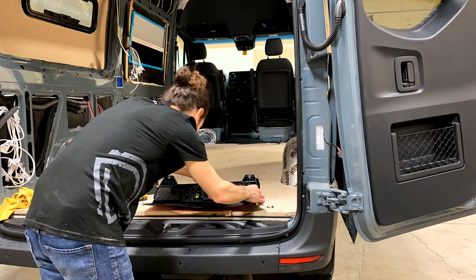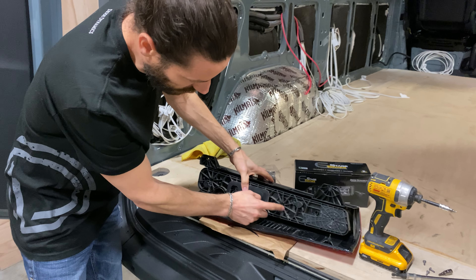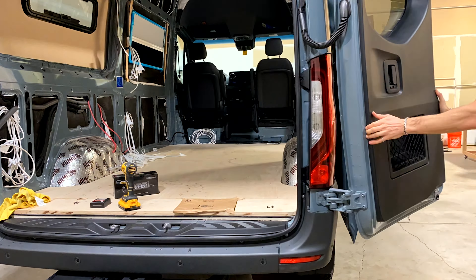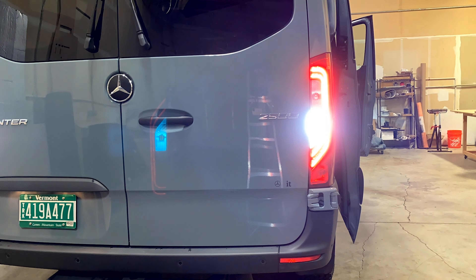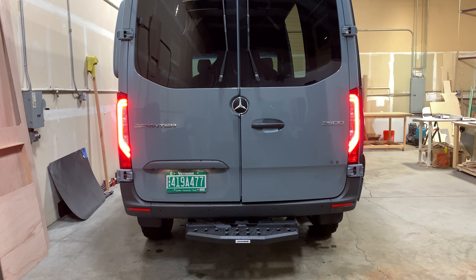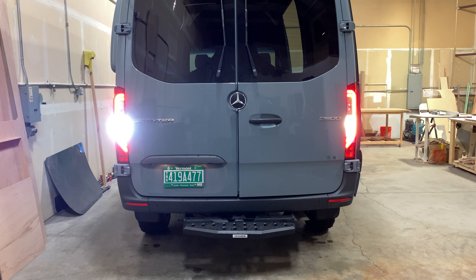This section is held on with one, two, three, four screws. So you just remove those four screws, pop this off, put your bulb in, snap it all back together, and the whole project's done. We'll show you in a second here how much brighter it is once you've done the replacement. In the video we'll have the OEM halogen bulb on this side and we'll have the LED bulb on the driver's side, and you can see the difference — it's well worth the 10 minutes it takes.